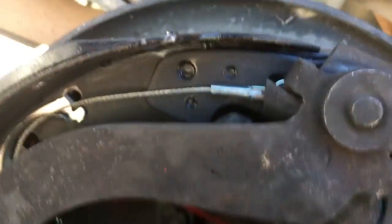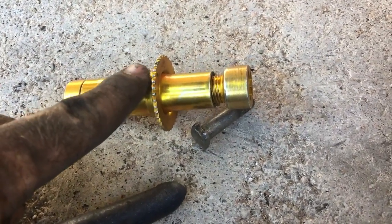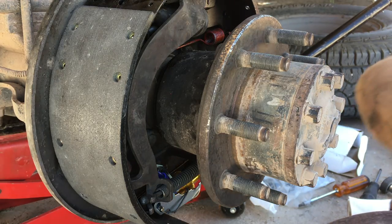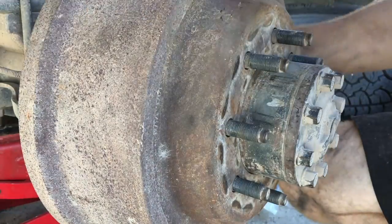The wire runs down — it's not in there right now but it goes over that groove on the little rail we put in and hooks in to the top right there. The side that the lever comes in, to hold this back from spinning backwards — that's the side I put the solid piece in. Put the top little bolt pieces in. I just push the rubber part in like this, and then I'll get a screwdriver and just pry it in. Now that I got that done, I take and wipe this out with some brake cleaner, and this goes back on.